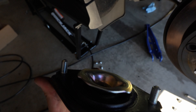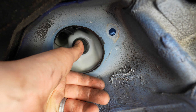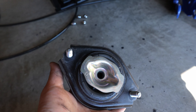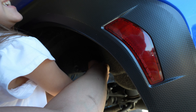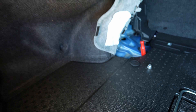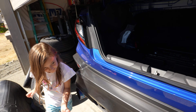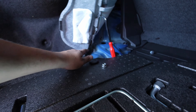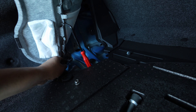What you're going to do is put the top hat in first from underneath, then bolt everything down up top. There's a little rubber piece you've got to push up and out to access the bolt hole from the top. Julia is actually going to hold it while I bolt it down. Now I can come over and tighten these down. You'll also have to use your panel popper to pop off a little clip right there — I used it to prop things up while I tighten everything.